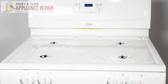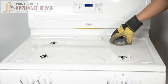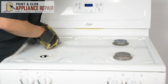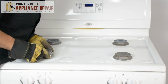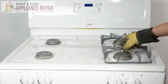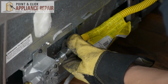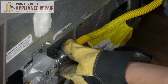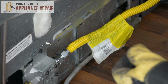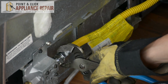Now that that's all screwed down, I can put our burners and burner caps back into place. So now we're going to reconnect our stove to the gas line. There we go. Tighten it the rest of the way with our channel locks.